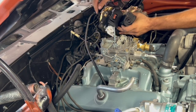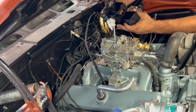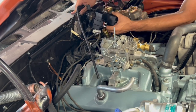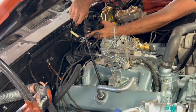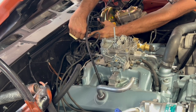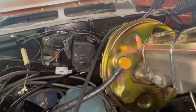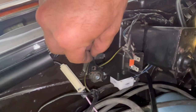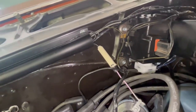We're going to install this bad boy into the firewall. There are three nozzles on the washer pump — the larger one is the inlet, and two smaller ones go to the left and right washer nozzles. Doesn't matter which is which — they're both the same. I've got the cowling already unbolted and removed. It fits in like so, then put your three bolts in. That's the last bolt. Now plug in the wiring — there's a single wire plug that goes right there to operate the motor.